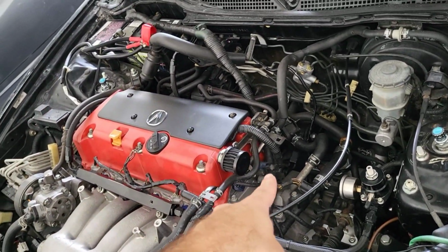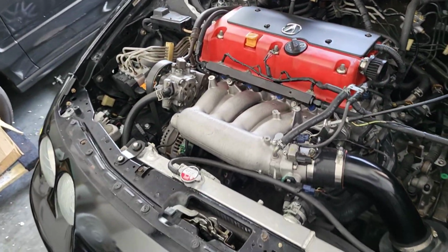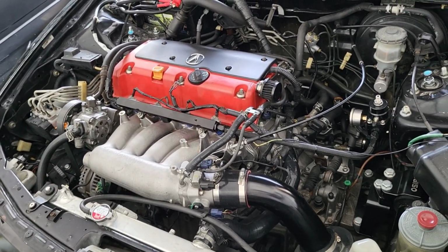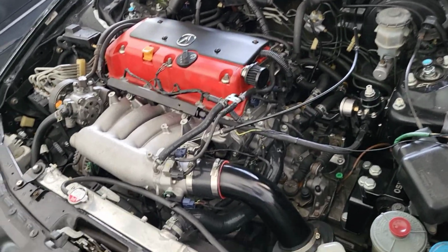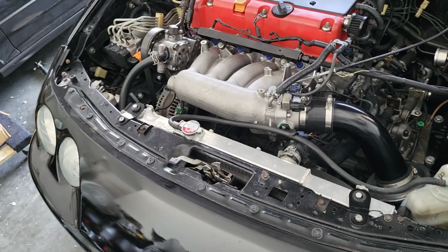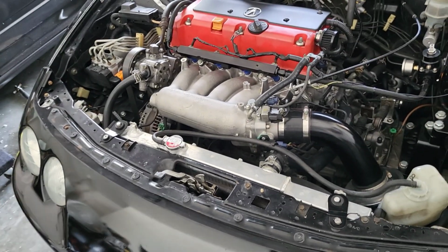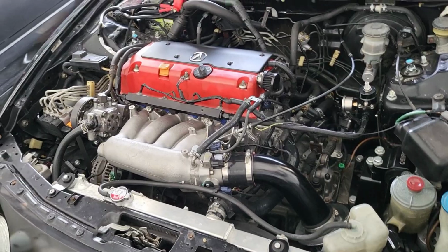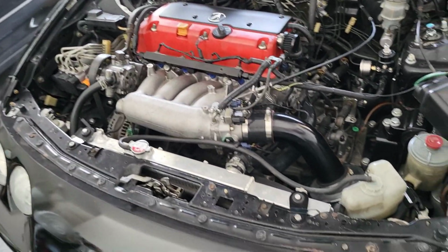The cylinder head temp sensor plays a huge part as well. And making sure that your head gasket is also how it's supposed to be. You can do a leak down test if you believe that it might be the head gasket, to rule that out or not. But yeah, those are quick, simple little tips and things to check out if you guys are experiencing overheating.